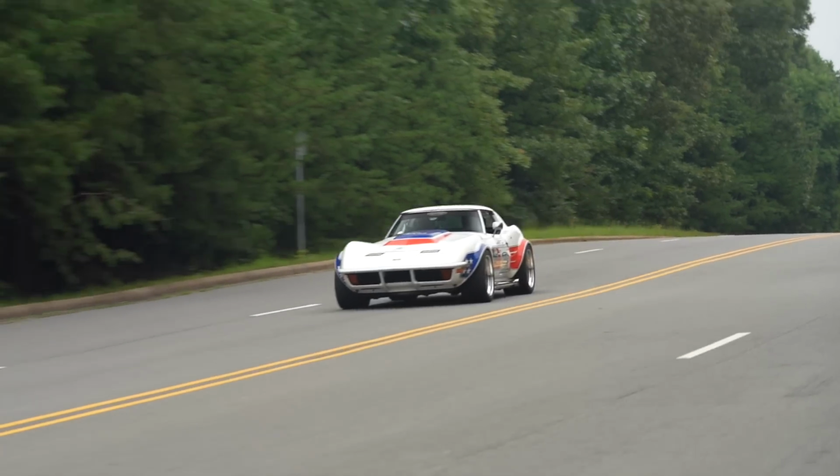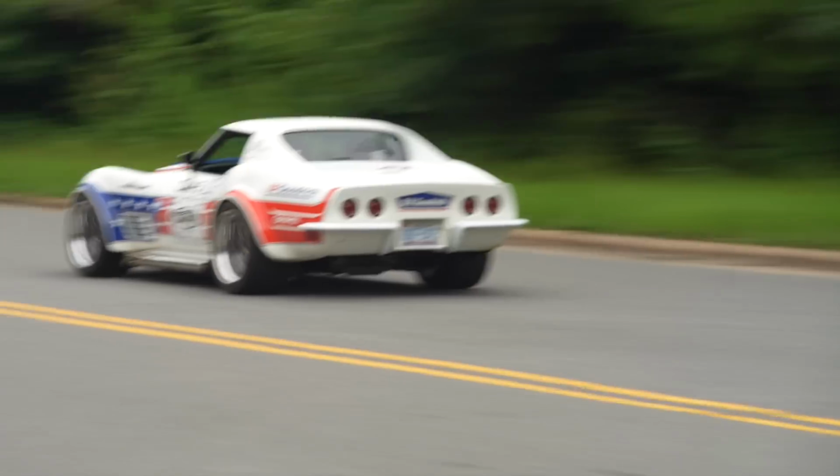So the little bit of bumping like that, that's because of the big cam? No, I would say it's because of the combination of a slightly heavier clutch with a lightweight flywheel. They just offset each other. It's like total race car, man. Oh yeah. So badass. Purpose built.